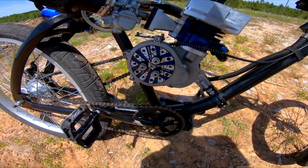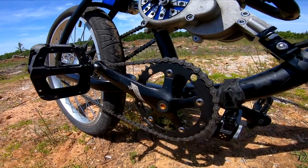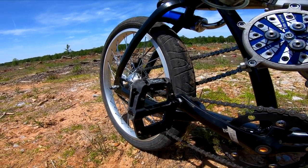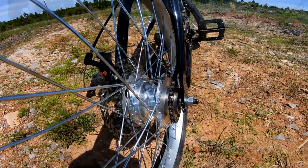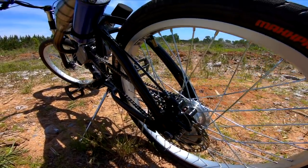We've gone with a smaller front chainring. I can't remember how many teeth, but I'll try to leave a link in the description when I find it. And these are some Fokker pedals, some nice studs on them to help you keep a good grip. We matched this up with a 22-tooth single speed to make it a little easier to pedal from a dead stop, along with a 36-tooth drive sprocket and a 415H chain.